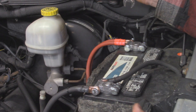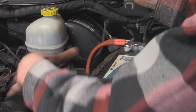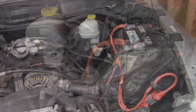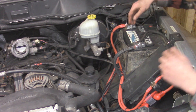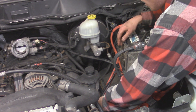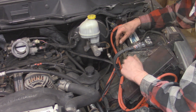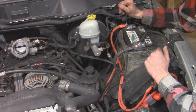Now that all cables are 100% installed, the only thing left is to put the air box back on top of the engine and button up all the extra wire with zip ties so everything looks tidy — no wires flopping around, no chafing or electrical issues in the future. Everything is all finished and the cables are nice and tight — a lot tighter than the factory wires which were just kind of flopping around. I've got plenty of clearance between the exhaust manifold and the steering shaft for the starter wire. Everything is looking really nice. Let's put the air box on and wrap up.